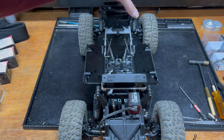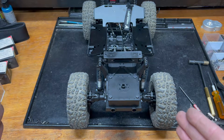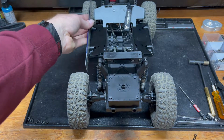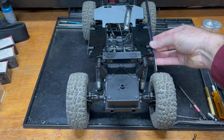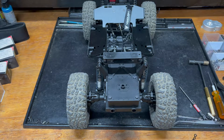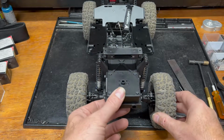And then the rear links, nothing is properly adjusted. So it's the same thing, but in the other direction. If we go right off of there, we're just to the middle of the innermost tread block. And if we go right here, we're at about the middle of the second tread block. So not as significant in the rear, and that's simply a matter of the links not being the same lengths. So everything is pushed over just a little bit.